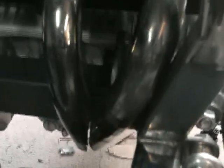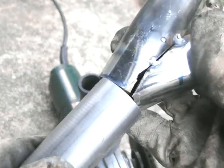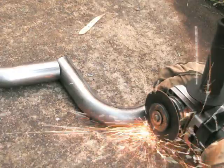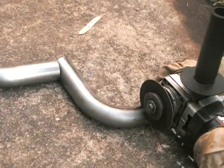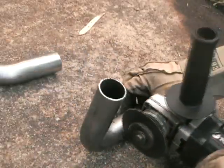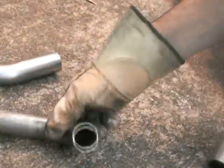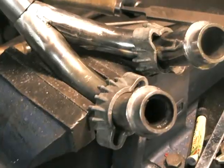You can see here it's getting close where I'm going to start welding this up. The first step is that two into one - here it is tacked, and you can see the bottom. I tidied that up a bit before I welded it so I actually joined that centre pipe as well. These are the two extra bends that are going to go through the frame. The last pipe will just be pretty much that end where the rear of the exhaust I'll expand out so it just slips over it. I'll have to do two sections like that otherwise I won't be able to get this exhaust system apart again.